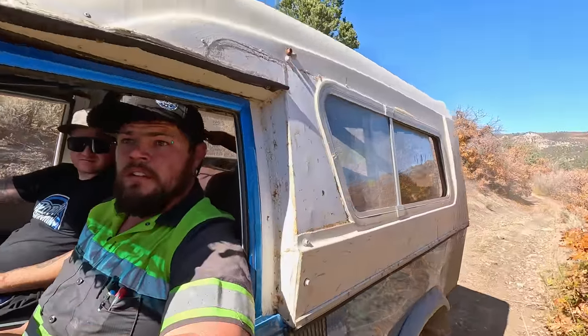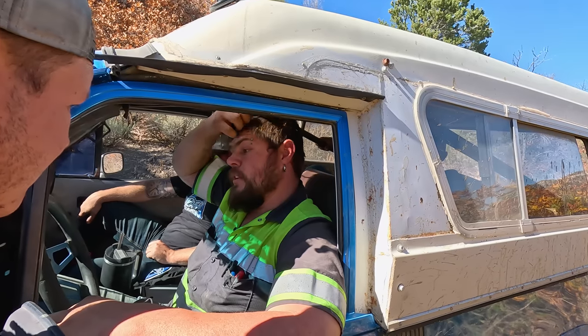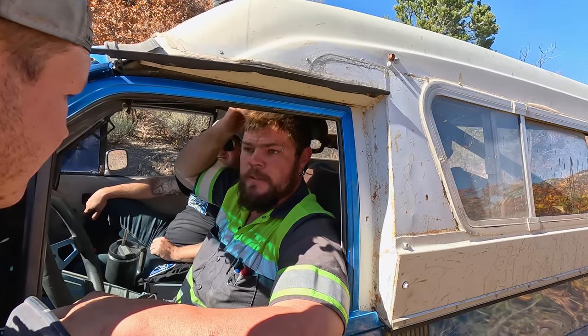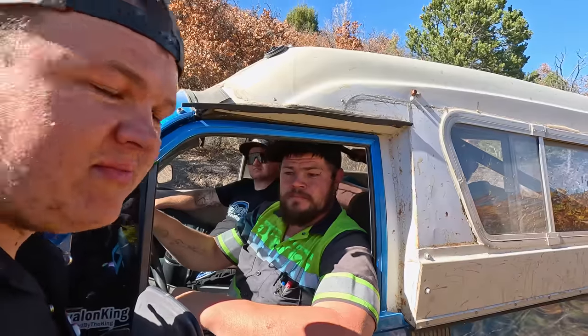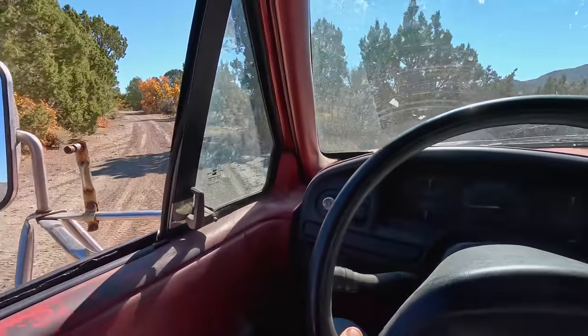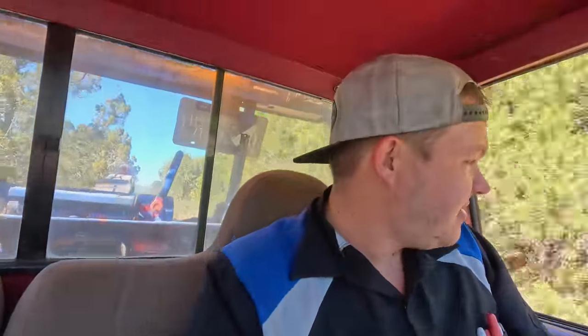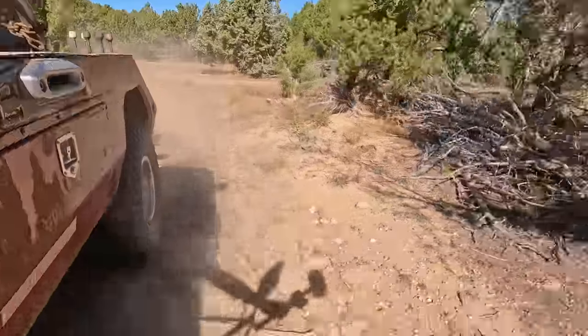Where have you been? I've been waiting for hours! I had to adjust the carburetor more because it was running hotter than normal - running too lean. The temperature's dropped and I got the idle down from 1600 RPMs. We're off to the abyss. This road is really rough and with 65 pounds of pressure in these tires - I don't know what Hillbilly was thinking. There are some rocks in the middle of the road but Robbie's doing pretty good.